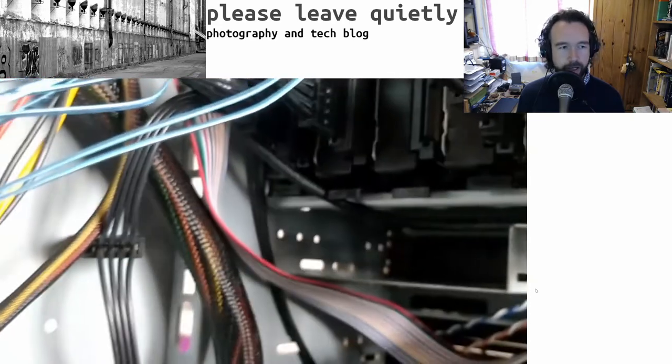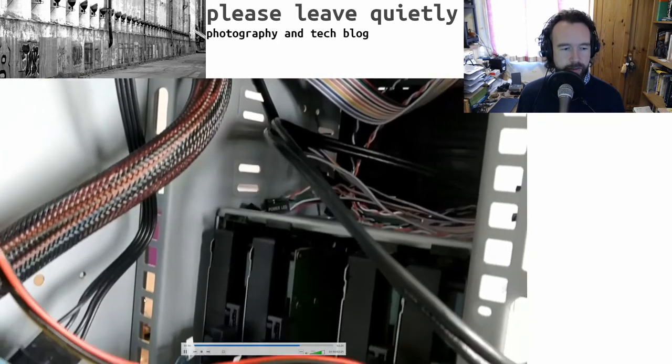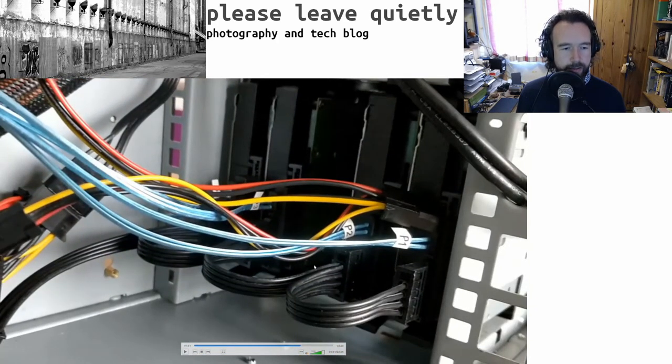You can see the breakout cables go to the hard drives. These are Molex to SATA converters and they're actually quite important for this - if you put SATA power directly into SAS drives they don't work, because there's a problem with voltage going down one of the pins that it shouldn't. If you convert from Molex - which is four-pin - to SATA power, you don't get that problem. And these breakout mini SAS cables go to that pass-through card. That's the solution to using SAS drives without a SAS backplane.